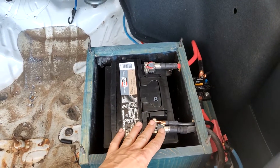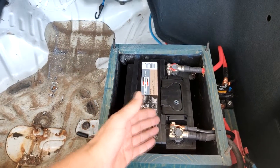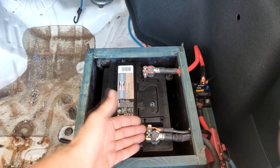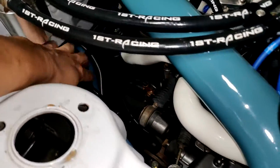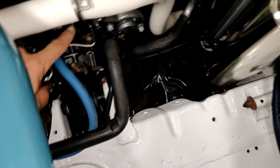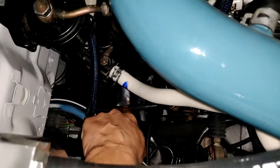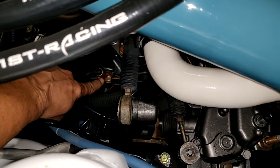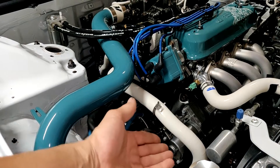What we need to do is bring the ground closest to the source — essentially how the car was set up before we relocated the battery. On mine, the ground runs to the transmission bell housing, about one foot away, so the current only has to travel one foot to return to the source. Right here you can see the positive cable running to the starter, and the ground wire bolted down to the transmission bell housing. The resistance is only about one foot through that bell housing from where it's drawing current to where the ground is.